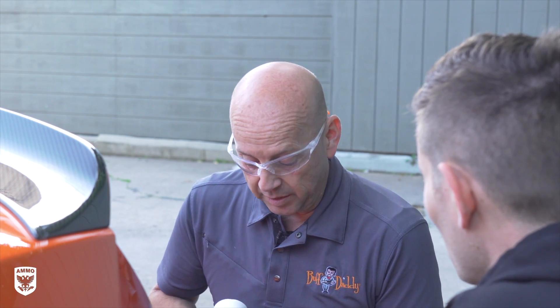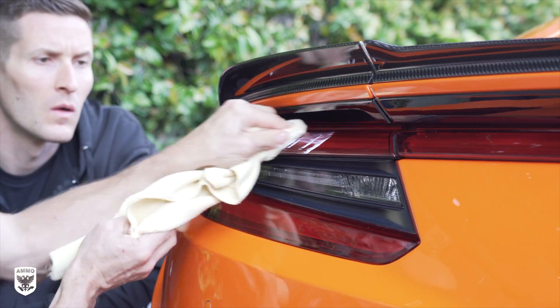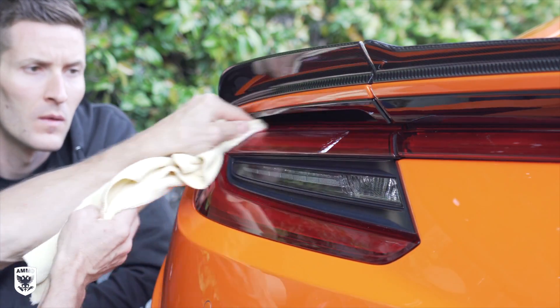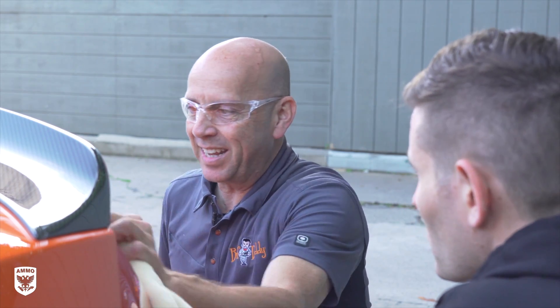So what's the difference between taillights and paint? They're pretty similar in terms of how you restore them. We can even use the same liquids, pads, and machines to restore the gloss and take away defects on plastic. This is a compound 110. Start with a microfiber towel, apply a little bit of compound, and scrub away. As you scrub away the defects, you're removing plastic residue. You want to stop and flip the towel to a new area to keep the polishing speed at maximum and not scour the plastic you've just polished.